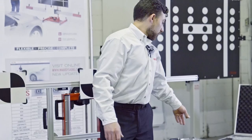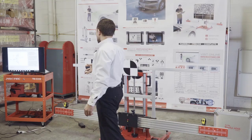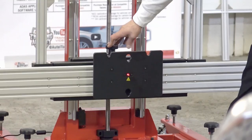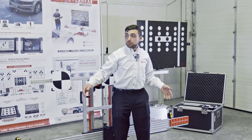Once attached, we turn on our laser and point it at the red ruler toward the front on the crossbar. Once we have our lasers shining on the rulers, there's no specific number we're looking for — the key is to have both values equal. We move the crossbar left or right so the value on both sides is the same. Right now I'm between the 160 and 165 mark on both sides.